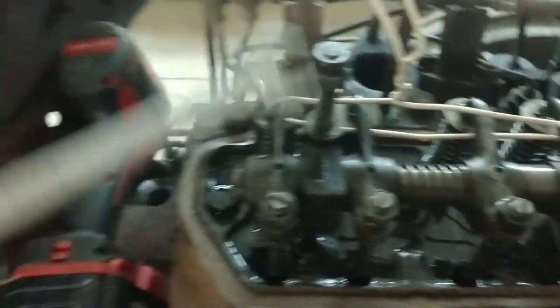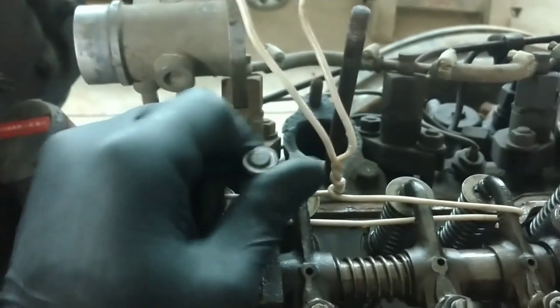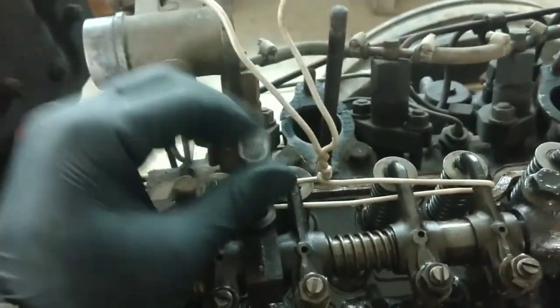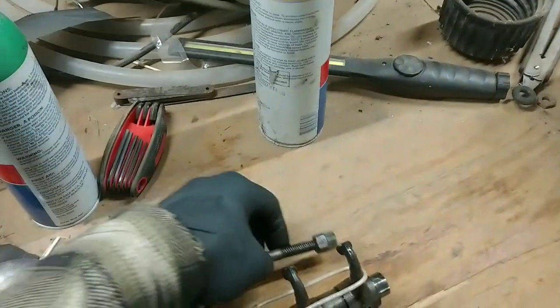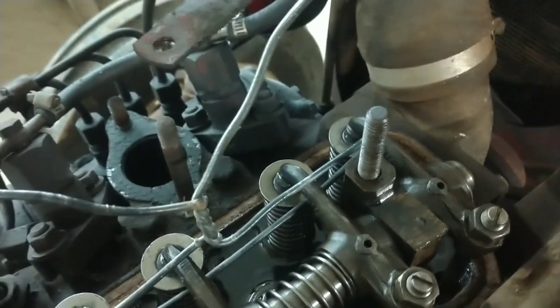Five years since my rebuild — I'm still calling that a success because I ain't had to work on it in five years. So if I've got to re-torque a head gasket, no big deal. On the gas big tractors like the 706, you're supposed to re-torque after a hundred hours. Nothing has been re-torqued on here. I'm going to see if these back two bolts, which I believe are causing the leak, see if she's still on — hang on, we're going for a ride.